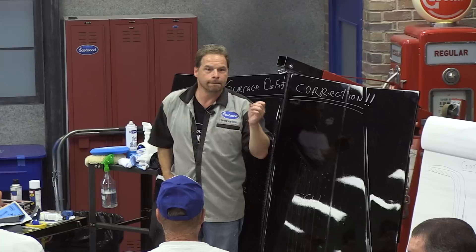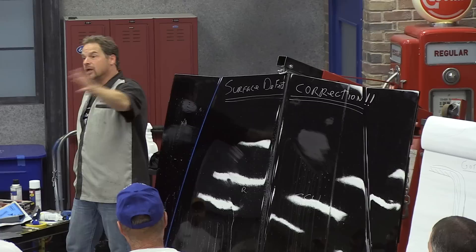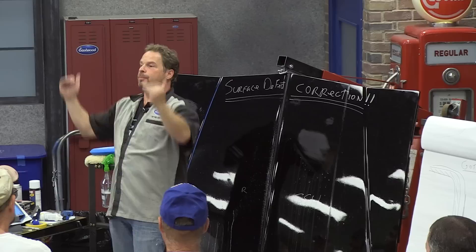Kevin, how long do you wait after scraping a run before you start color sanding and buffing? If I'm doing a show car, I'm going to cut it, leave it for a week or two weeks, then come back and rub. The reason is that when you open up the top skin of a panel, it's important to understand — paint skins over, it dries from the top down. But paint cures from the bottom up, while drying from the top down. You've got two actions happening at once — a layer in here with solvents, whether water or traditional solvent, that's trapped.